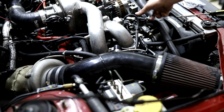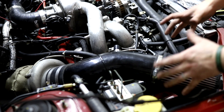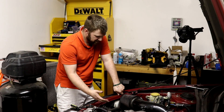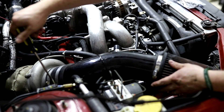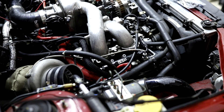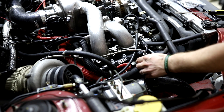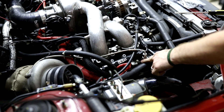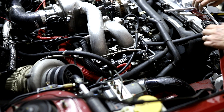We're going to take this intake off. With the factory setup you've got the turbo inlet coming through here, that S-pipe, and the air box — you may have to pop that air box out, which takes about five to ten minutes. With a big air intake like this it's really simple to remove. The solenoid is right here, same spot as the other side, and we'll also have to pull the vacuum line for the PCV just like before.